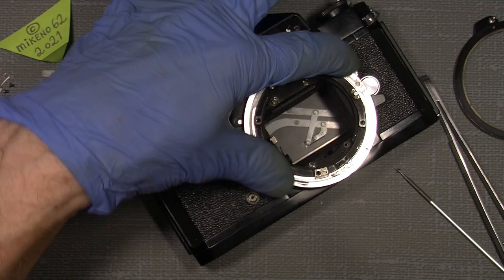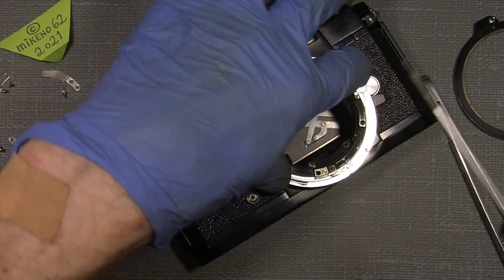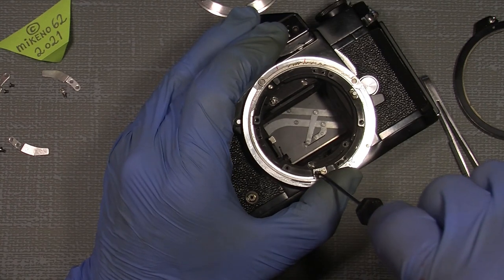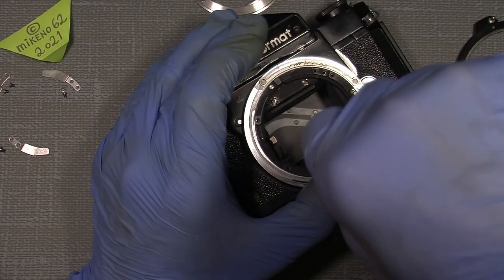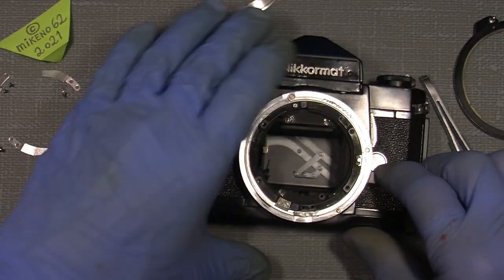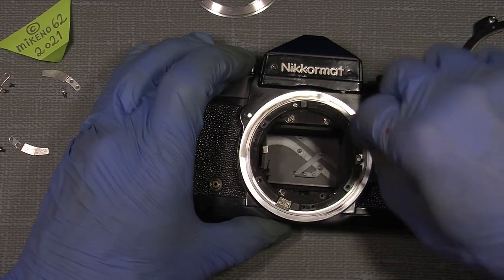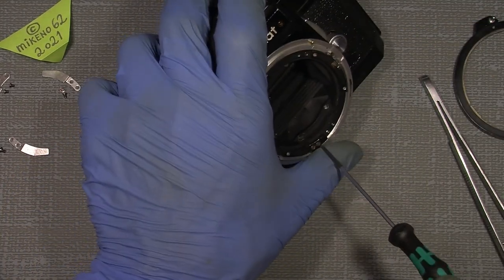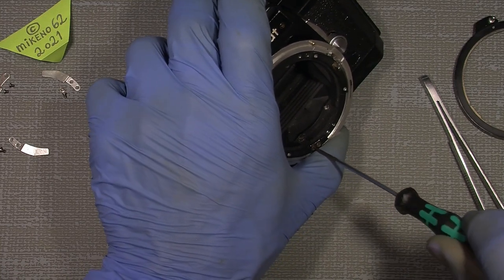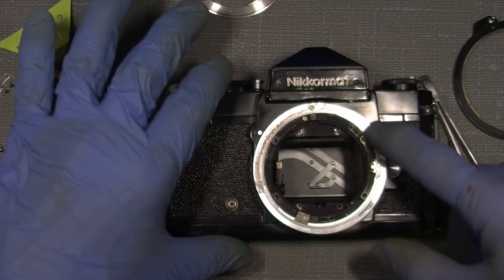Because when I move the max aperture scale ring — as it says in the repair manual — you can see it works really good. I can tighten the two screws here gently. Wow, smooth and nice — that's really good, it works much much better and smooth.